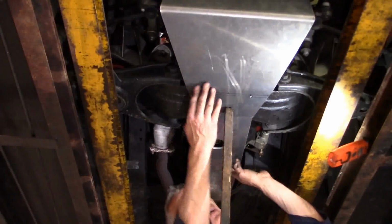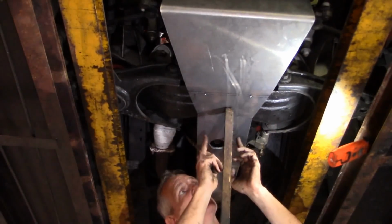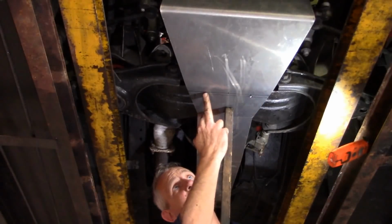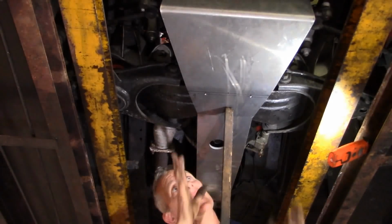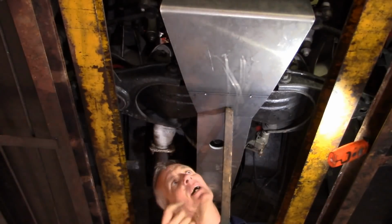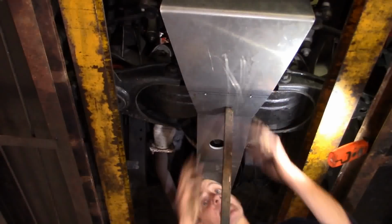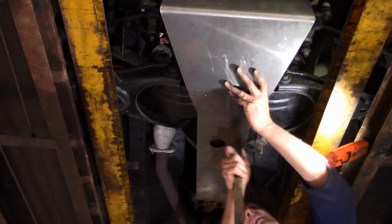So now we de-rig both units to drill the M8 hole through the steering and the sump guard and countersink the steering guard, and to open out the cross member holes to M8, and then that's final assembly after that. So let's take it apart.